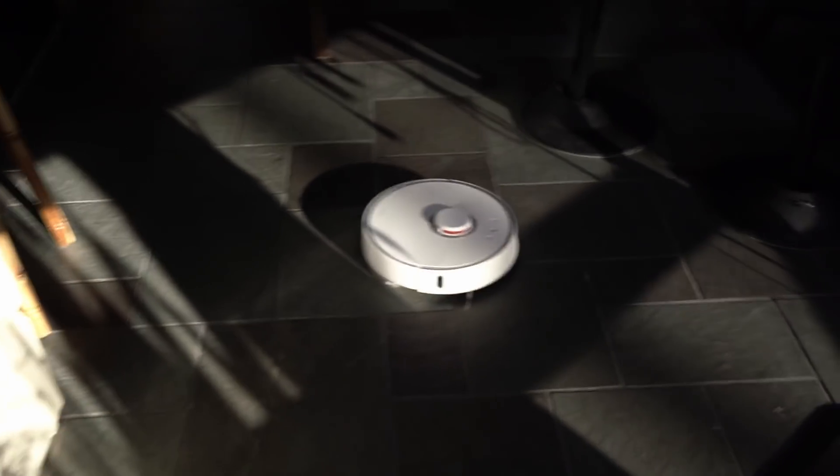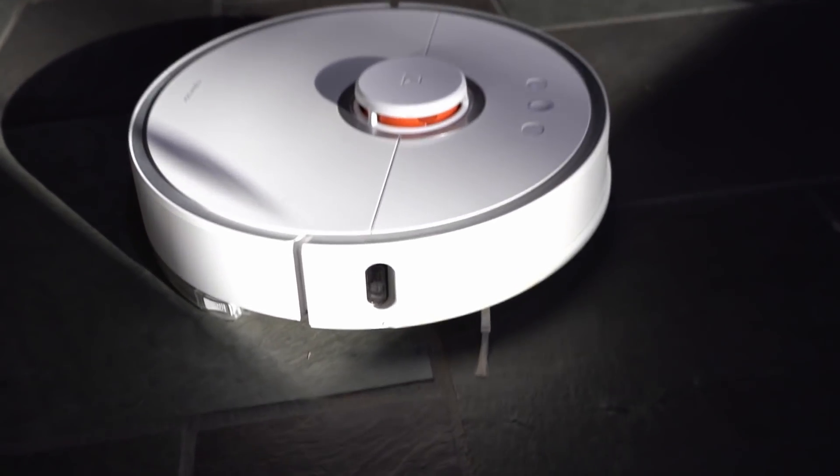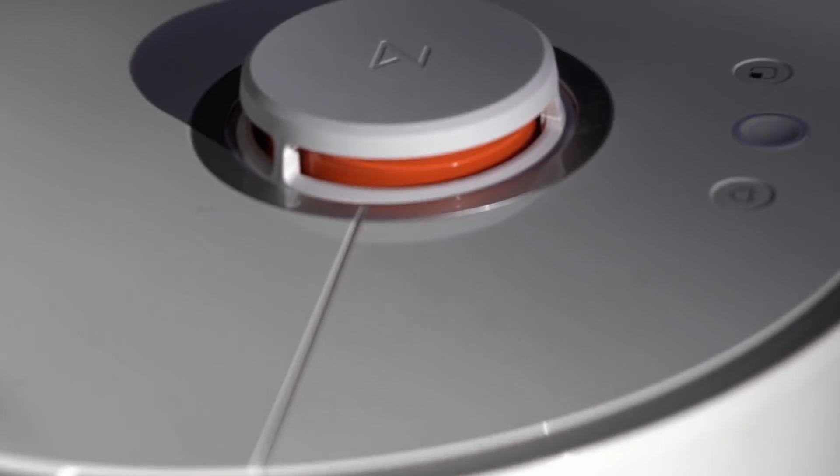So the last thing I'm going to show you is how we do the voice commands. There's a really slick program called MIIO that interfaces with much of the Xiaomi ecosystem of devices, including the robot, with a command line option called MIRobot. You just call that with the Mr. House code that I have set up to work with either the Amazon device or the Google device. So I can say: Hey Google, ask house to find robot. Okay — that's the find command. I'm over here. Or I can say: Alexa, ask house to start vacuum. Starting the cleanup — and there goes the LiDAR, and it maps out and starts.